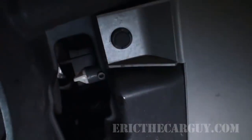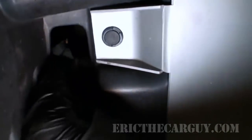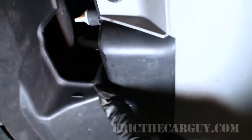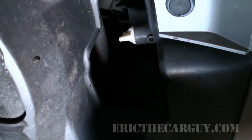Located up under the center here of the front bumper, so go from the front license plate almost straight back. You'll see the drain for the radiator, and you'll see a little hole there. And hopefully all the stuff will come out that little hole. But that's what we're going to do. We're just going to turn that little petcock counterclockwise, and sometimes you might need to get a pair of pliers or something. In fact, that's what I might need to do here in order to get this loose. But be very careful, it's plastic, you don't want to break it. So just knock this loose and allow the coolant to drain out there until it stops draining.